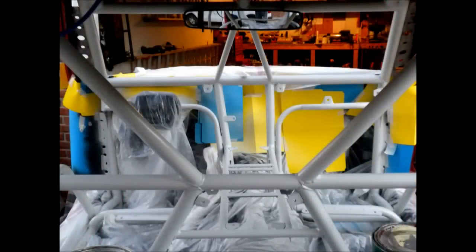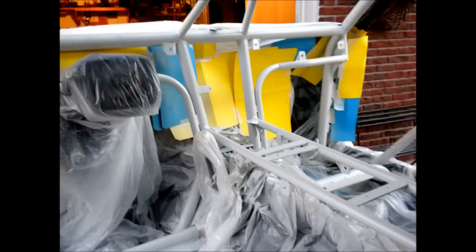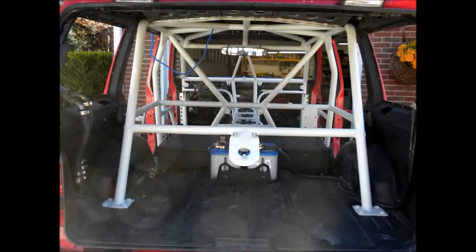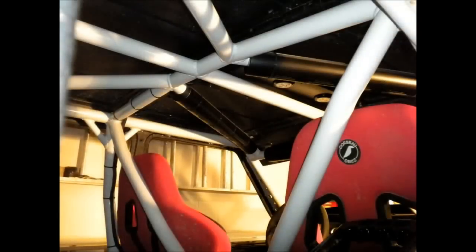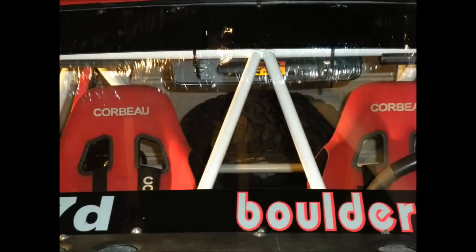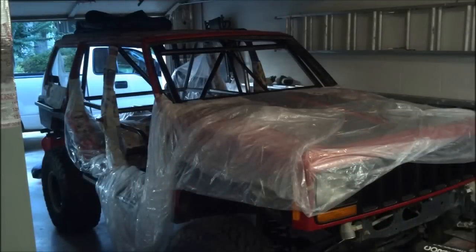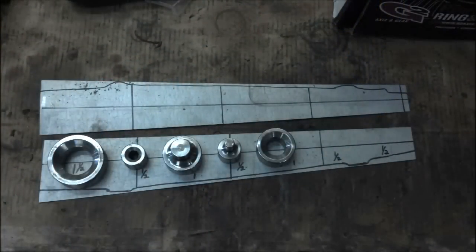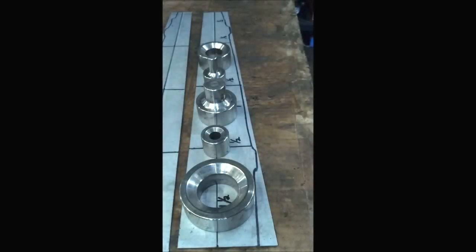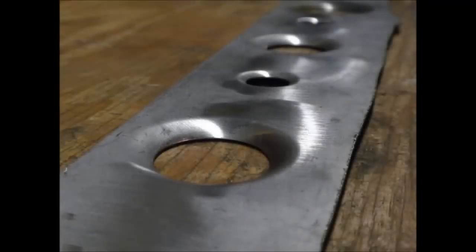Here you can see some of the tabs on the sheet metal — these are for the body panels. There's the spare tire mount. All the panels were being fitted at this point. We went through an elaborate stage of templates and transferring those to sheet metal — it was quite a bit of work. Here are some of the sheet metal frame-to-roll-cage tie-ins. This is where you want to tie it in. If you don't tie your body to your roll cage, they're going to move independently. You need to get it tied in at the highest point, so I have 15 pieces throughout.